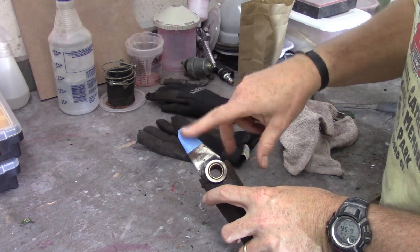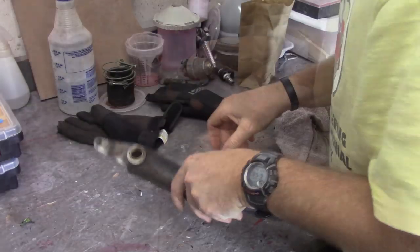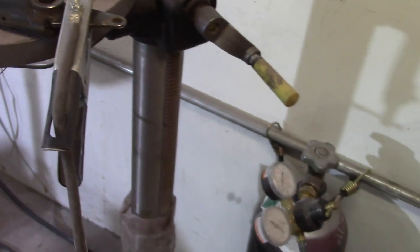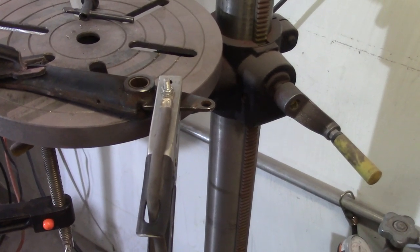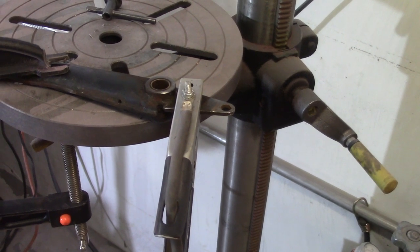So now that I've got that, I don't expect the top and the bottom of the hole to have been compromised at all, so I'm going to use that as a center mark, then right to left center it up and just assume the center of the hole is in the center of this peak. Then weld it up, take the tape off, put the tape back down, find the center again - and now I'll go ahead and fill that in with weld metal. I'll crank the welder up - thick metal here, I can get away with higher currents.